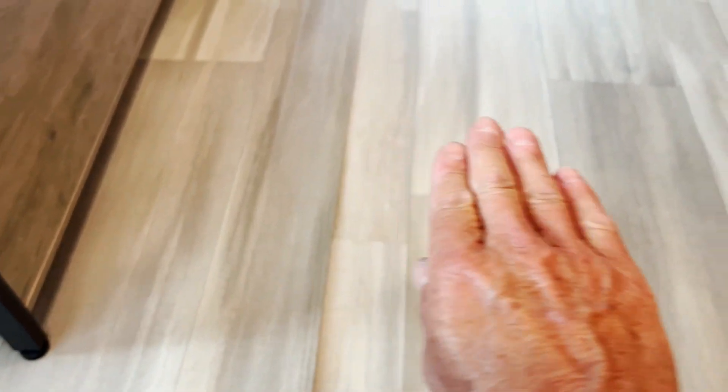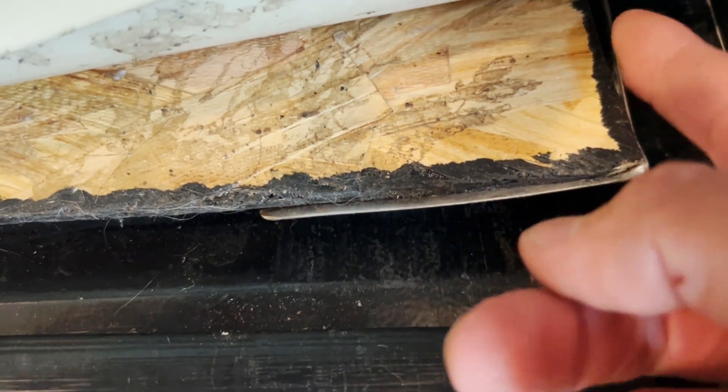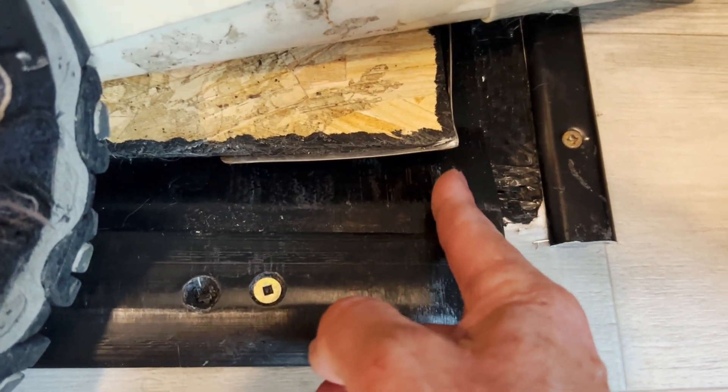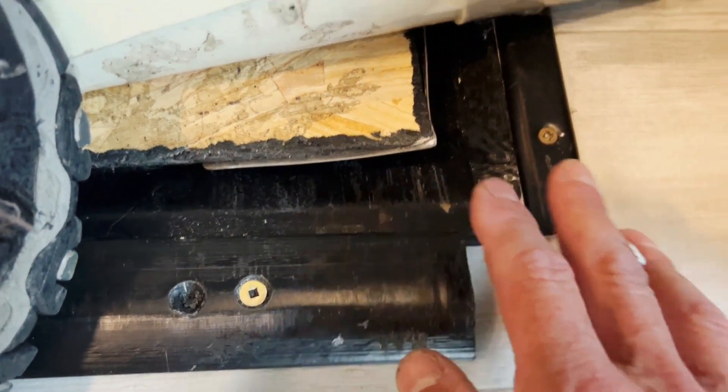This is an Alliance Paradigm, and I think all the Alliances are put together like this with the flush floor. Flush floor means there's no lip — it's just floor and floor, with the vinyl hanging over. Some slide-outs have a one-inch lip and come straight in, but the way these Alliances work, they come in and go up and over, and when you retract them they fall in to make it flush. In comparison, walking to the other end of this slide, you can see the slide ski is much closer to the OSB here. I had to move this wear bar as well, but the slide ski will still be completely on top and not hanging over on the wear bar. It just depends on your particular slide application.